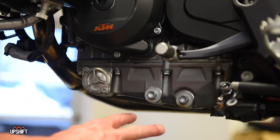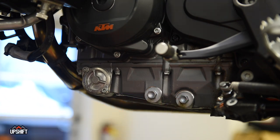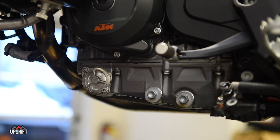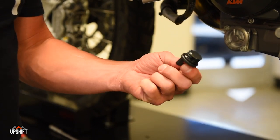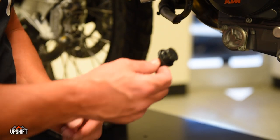Back on the left side of the bike, these are your two drain bolts — they're 13 millimeters. Pull these out to release the oil. And then this is our oil filter here, two eight mils — we'll pull that out and replace the filter as well. One little trick we like to do is to pull the oil filler plug out and leave it on our bench, so we don't get overly excited and start this thing up before we put oil back in it.